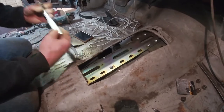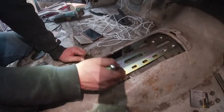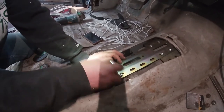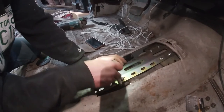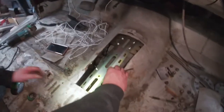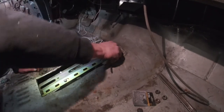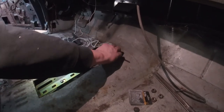Once upon a time. Did this bolt change sizes? Is this bolt still 9/16? Yeah. Problem is that you don't have enough throw there on your ratchet to get it to click. I know. Probably be easier to do that from underneath the car with an extension. Yeah, that's what I'm thinking now. I just wanted to make sure I could snug it up from top side with the Allen heads before I went down there. Gotcha. Now that everything's getting snugged, it feels like it's not gonna go anywhere. Feels pretty solid. Still gotta do those two bolts on the tail shaft.